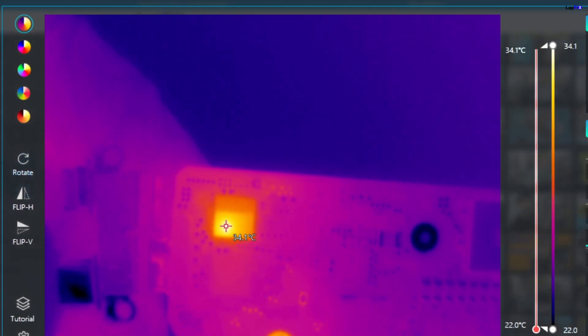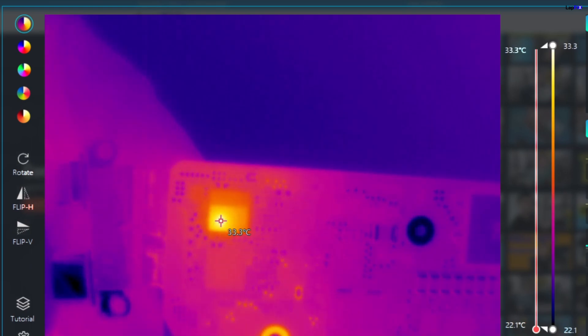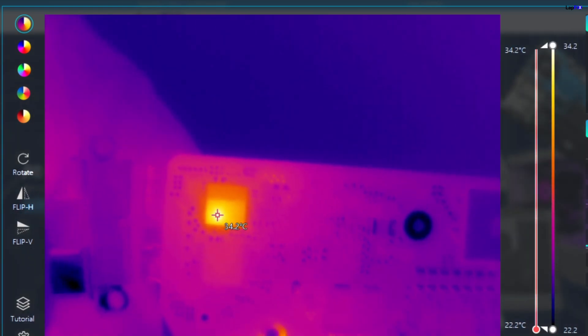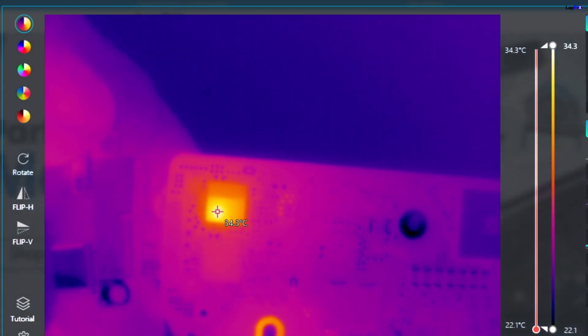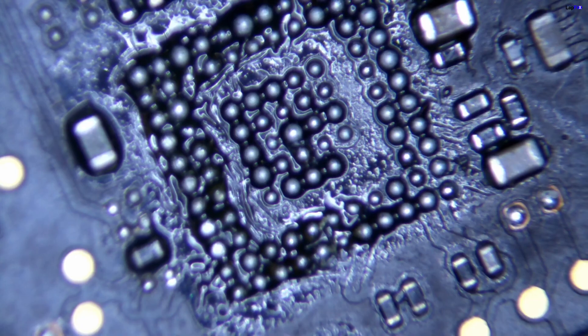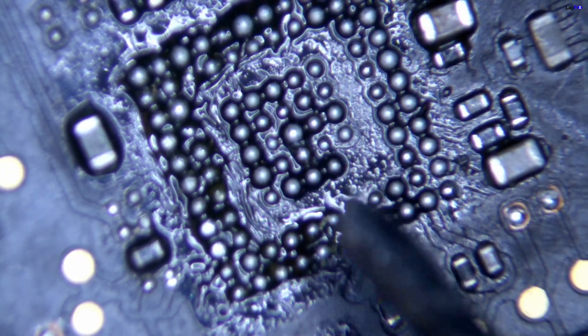Most of the time for these, you need both USB-C ICs working for the laptop to function. So what we need to do first is try to do a reflow on this USB-C IC, and if that doesn't work or there's still a problem, we're going to replace it. The recording didn't capture the chip removal — we really do apologize about that.